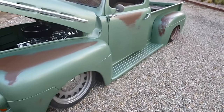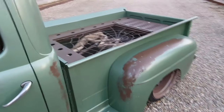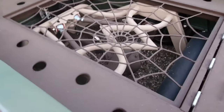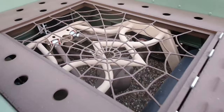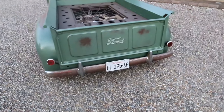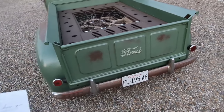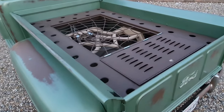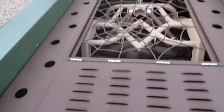The differential is a Ford 9 inch with big bearings, 3.50 posi and Moser 31 spline axles. Suspension is Mustang 2 front with rack and pinion, 2-inch drop spindles, rear section triangulated, and four links, Bilstein shocks, airbags with two wire compressor, 5-gallon tank, and a Little Larry controller.